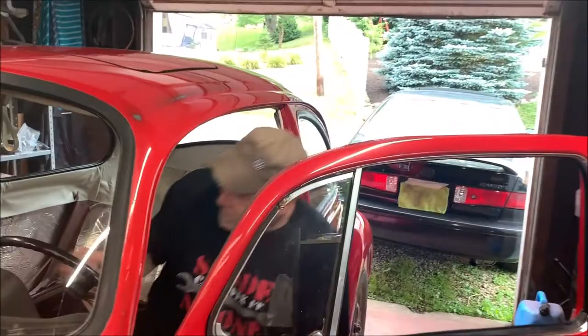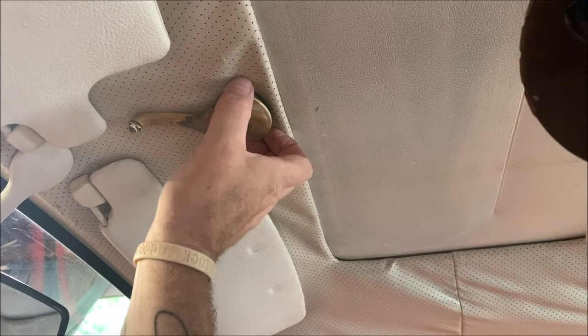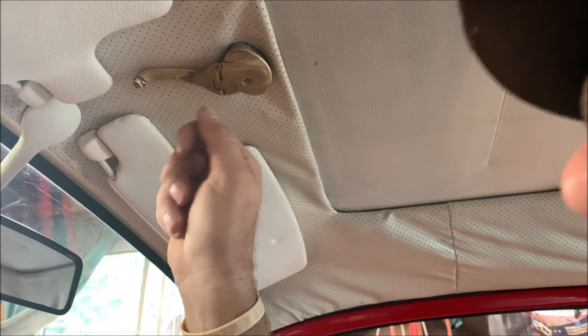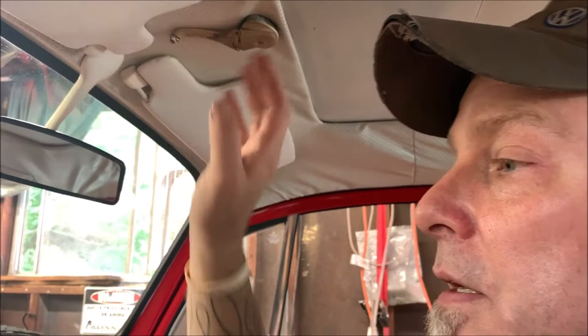Now remember, you've taken, I'll show you what screws I mean, in here. There's two screws that hold the crank handle up in. There's a cover over mine. Loosen those two screws up, 6 full turns. Don't go no further. And the gear will pull down away from the cables, okay? At that point, crank it clockwise to the closed position until it stops. They have stops in them, believe it or not. They just don't keep turning. Turn, turn, turn, turn, boom. It'll stop eventually. When it does, leave it clockwise as closed position. Leave it alone, okay?